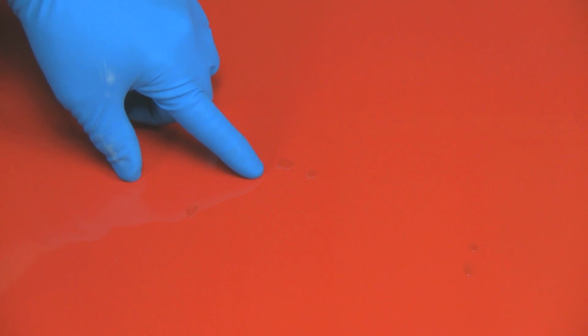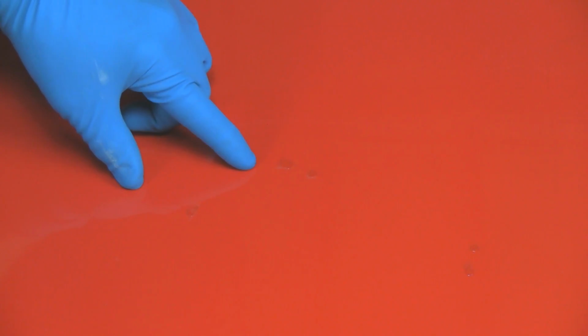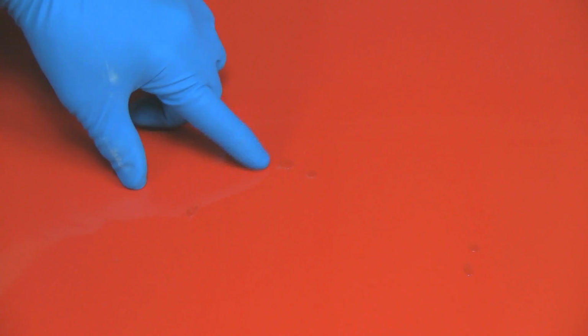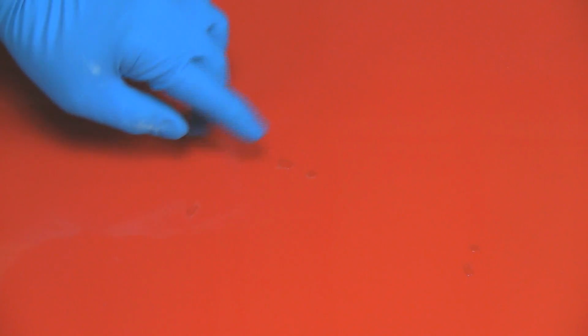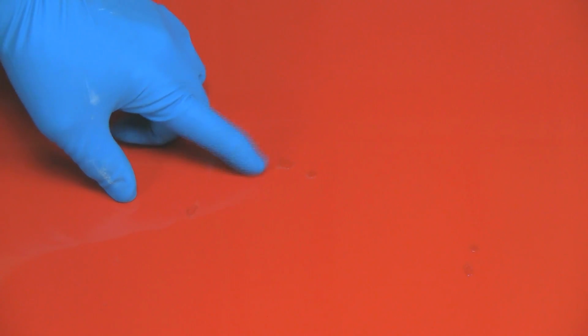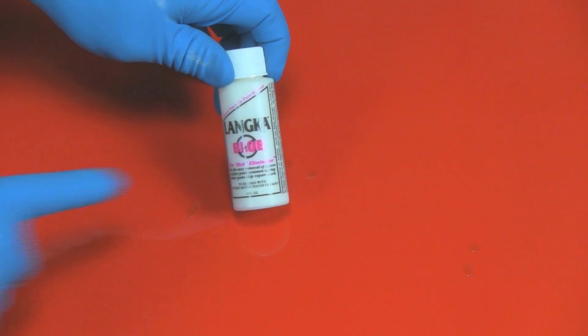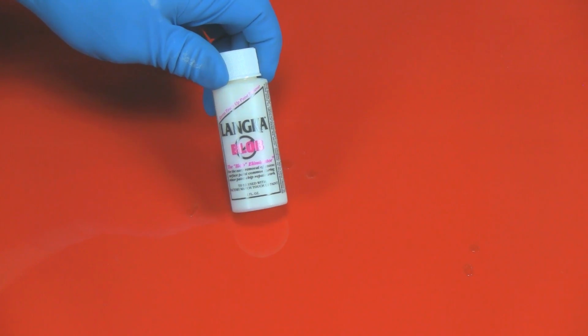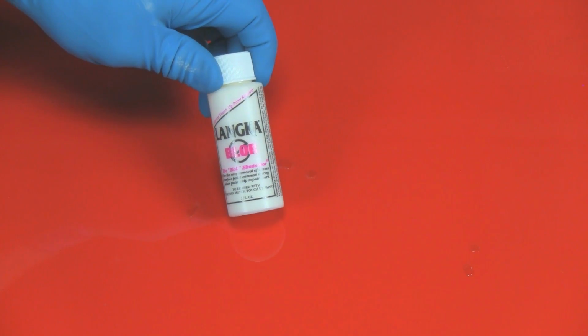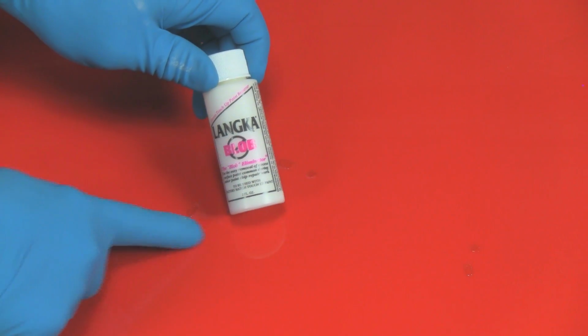All right, now we've been letting this paint cure probably for about 20 minutes on this one. We're going to start the removal process. If the paint's not cured enough, we'll simply pull too much paint out. We'll stop, apply more paint, and wait a little bit longer. For the moment, let's get to that. Here's the actual blob eliminator. This is what melts the paint as if we were using liquid sandpaper, so we don't damage the surrounding area.